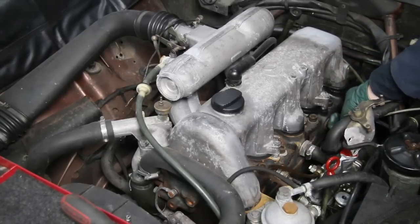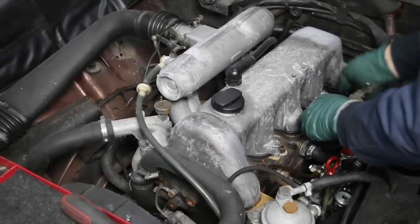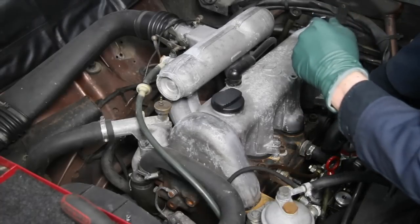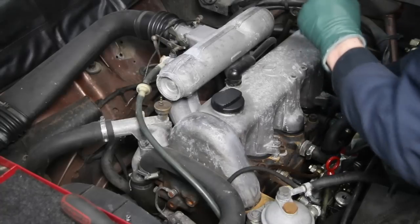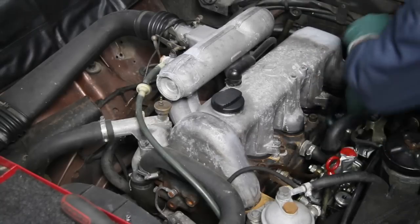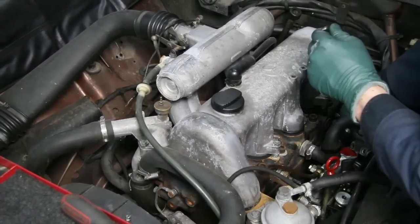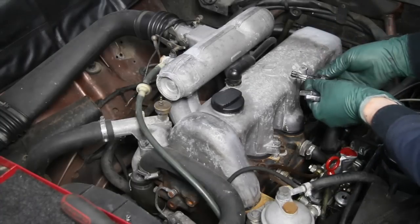Let's go back in here. It's binding up a little bit — you have to be careful, don't force it. If you're having to put a lot of torque on the wrench, there's something wrong. You just want to lightly tighten this down until it goes down and stops, and then you're done. I can see the reamer down in the pre-chamber. Let's take the reamer out and see how much carbon we got here — that's not too bad.